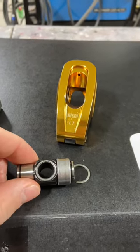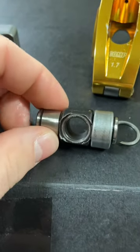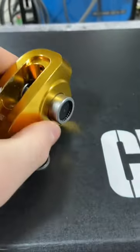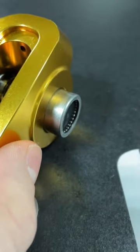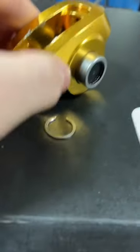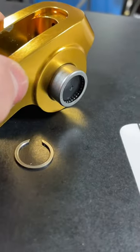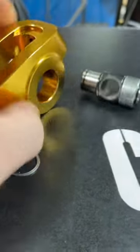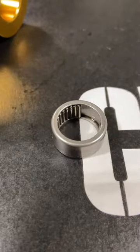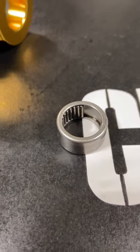So let's talk about a fail with this rocker arm. This is the mechanism that rides on the inside of the rocker right here. It's such a tight fit I can't even push it in, and it had the ability to pop the snap ring off that holds that on, shoot it out, and then dump all those needle bearings that ride inside of there into the engine.